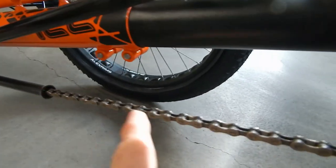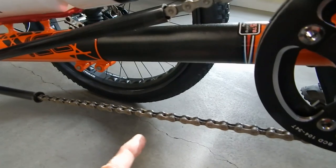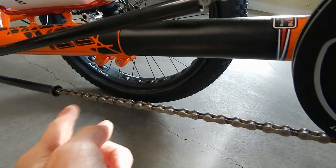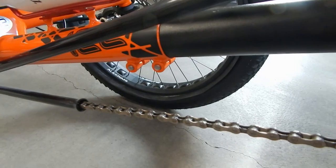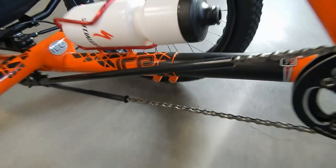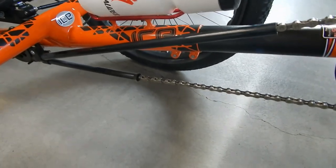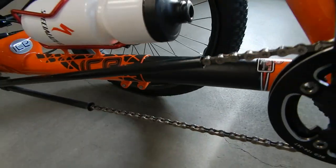This chain here — I would like to see ICE bring this chain tube out a little more, because the exposed chain, if there's any lubricant on it, gets on your pants. I suspect they may have it short to allow for chain movement for folks with a front derailleur setup, and most people do. But for this trike it's a compromise because the chain does not move laterally. Eventually I'd like to get a longer piece of tubing that would match the one on top.